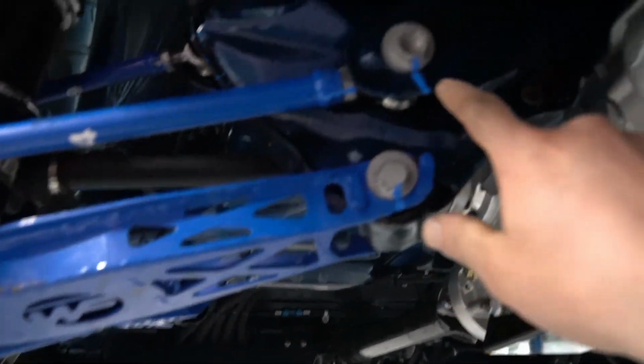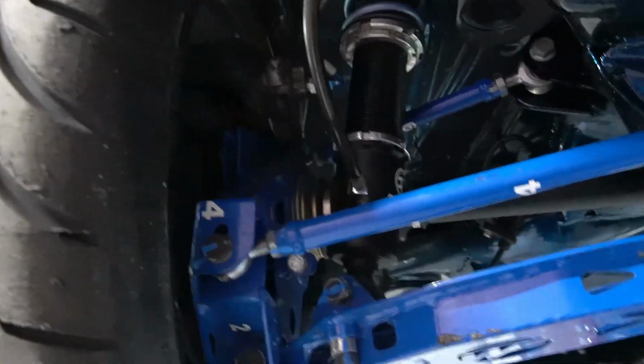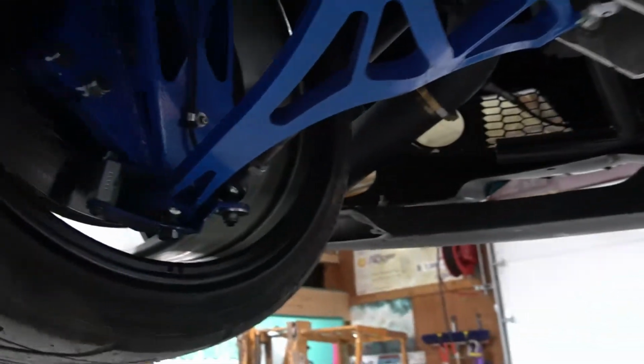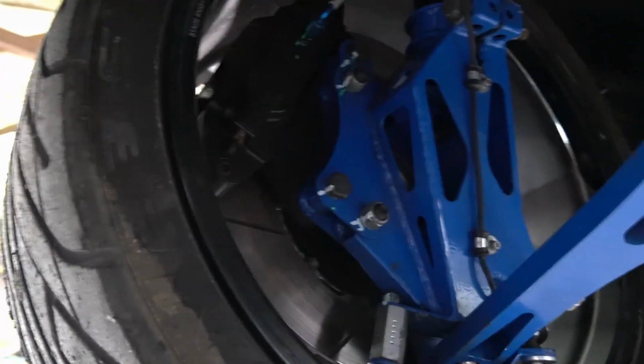We've been through, as you can see here, nut and bolt the whole rear end, drive shaft, and the big old beast of a gearbox. She's still there. Nut and bolted all the front end here, as you can see all those marks. So we're going to drop this thing back down on the ground, get some engine oil in there and fire it up, maybe run it through some gears, make sure that diff doesn't make any weird noises, and that part of it's good to go. We've got some cleaning, bash bar to fix, and mount the rear bumper, and we're going pretty good.